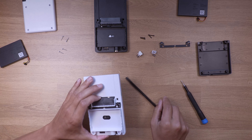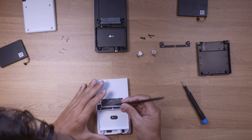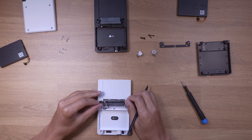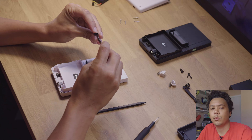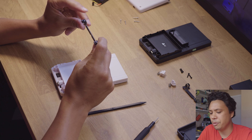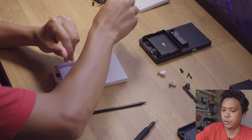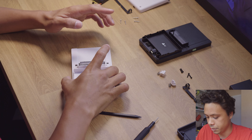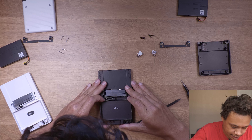There's a very small tab right there — you push it down and it kind of pops up. If you just lift it from the side it's pretty simple, but be careful because there's a ribbon right here. Once you get that ribbon, pop it out. One of the things I don't like most about the Pocket is the L&R buttons — they're mushy and they don't feel very good. I'm thinking about swapping them out with clicky ones eventually, but not today. I want to find the exact same sized ones so they fit perfectly.